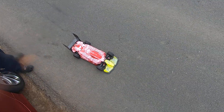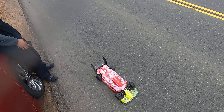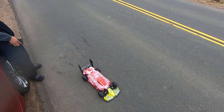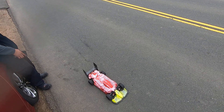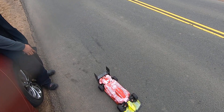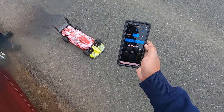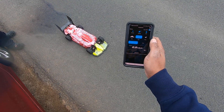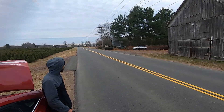All right y'all, we're out again with the limitless, re-geared — dropped it down a couple teeth on the pinion. Last time got 160 but it got so hot, so I dropped the teeth down on the pinion. This TP 2200 pulls a lot of amps, so without further ado, I'm tracking — gonna get a run.